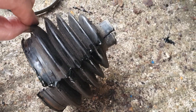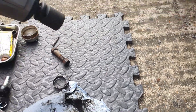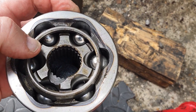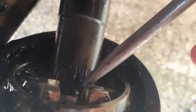I've got the boot off — that was a nice filthy dirty job. I split it down with a knife after getting the clamps off. Quick correction: I kept calling it a ratchet driver earlier — it's actually an impact wrench. That's what I used to get the nut off the end of this shaft. Quite conveniently, I've just looked in the new CV joint and you can see a cutout just there — that is where the circlip is. I've cleaned this up as best I can, and you can see the circlip just there — the light's not very good but that is it.